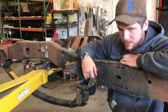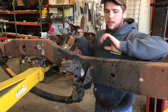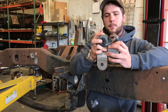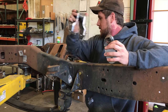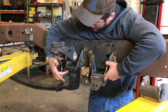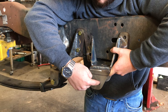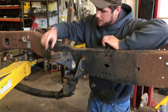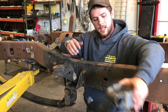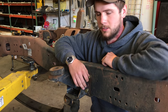What we have here are our low profile shackle hangers. These are specifically designed to work with our 2-inch shackles. Here I have a 2-inch shackle and a 3-inch shackle for comparison. We actually removed the top portion of metal because compared to factory shackle hangers, the mounting hole for these is one inch up and one inch forward of the factory hole. We designed these specifically to work with our 2-inch shackles because of the tight bend in the shoulder and the low clearance to achieve a true two inches of lift. These mount off the factory six holes in the frame from your original leaf spring hanger.